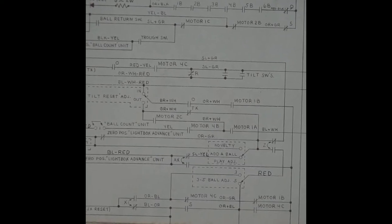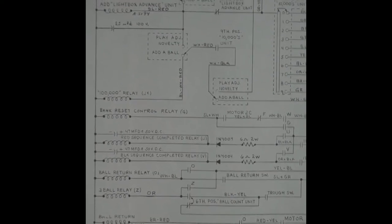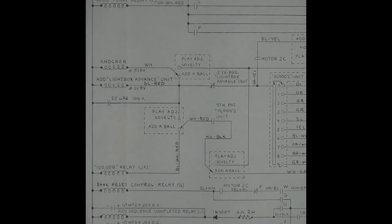The resets are the same — both units keep getting pulses until they step down to zero. It's all a matter of what adds to each unit. Look carefully at what you did for the add coils on each unit. If in the novelty position you're putting voltage somewhere you shouldn't, you'd have to break that connection — and that connection is actually made or not made by the plug being in addaball or novelty. They also put in a capacitor — we think that's just for arcing on the wipers and is not required.